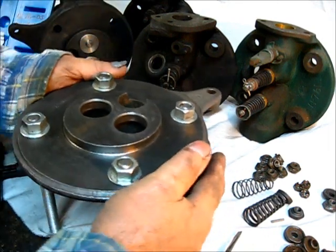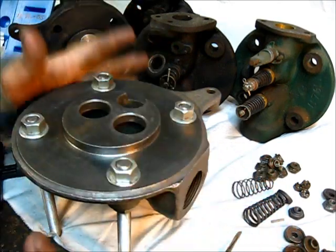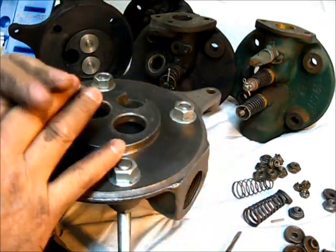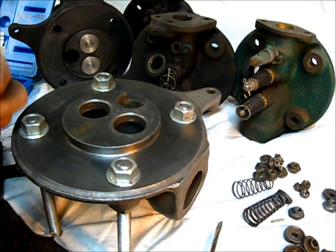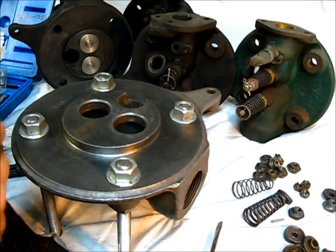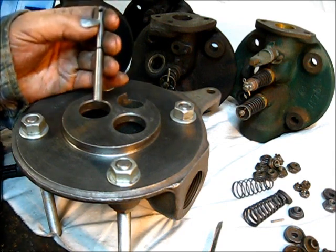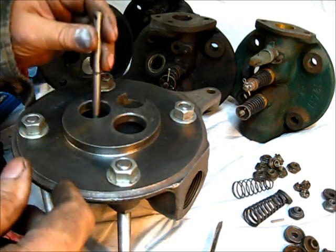Not to tarry — remember you need a secure head. To recap: we have installed the valve guides, fitted the valve stems to the guide. We're completed with that — valve guides are an operation in themselves. I did mic the valve stem and I know that it's point three one one — three hundred and eleven thousandths — so I choose this pilot accordingly.